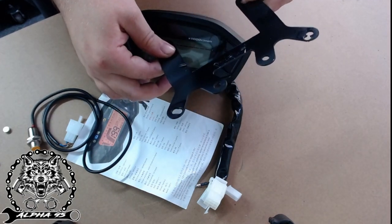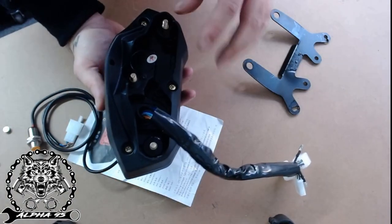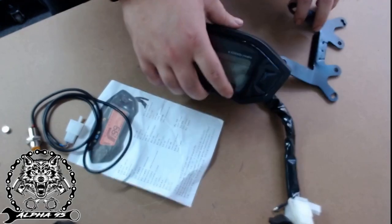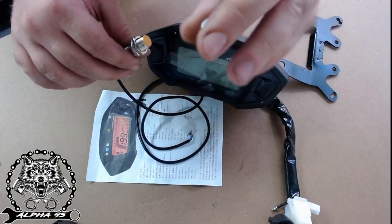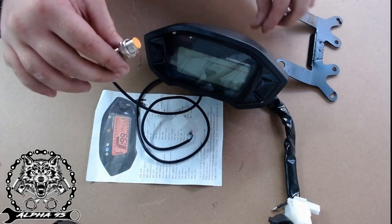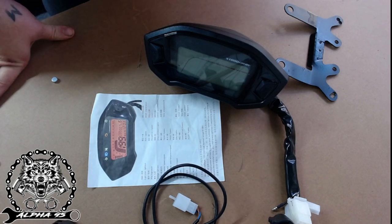I've got one of these just for simple mounting for the minute because I didn't want to go making custom brackets. I've cut this off and widened the two holes out here to accommodate for the two bolts that stick out on each side. Another thing we're doing slightly differently - they come with these magnet speedos and you get two little magnets. Normally you put these on the wheel and as it goes past a sensor that picks up your speed. We're doing away with this - what we have instead is a digital speedo drive on the wheel, which makes it a little bit easier and a cleaner job.